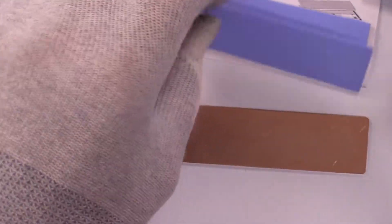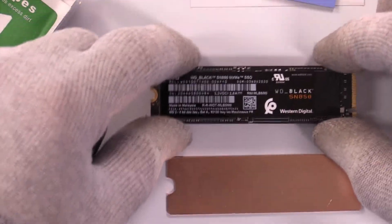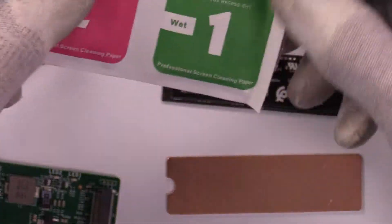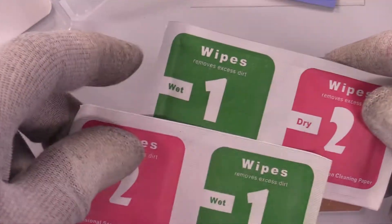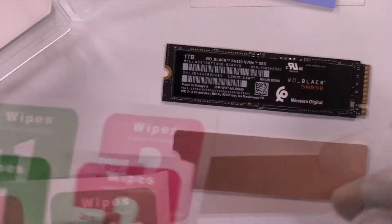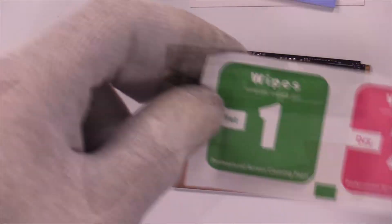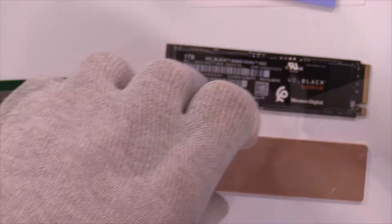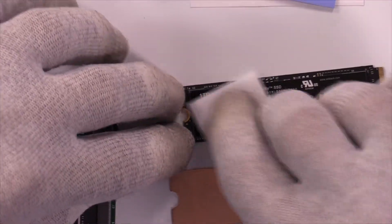In this setup, the thick pads are closest to the copper. As always, follow manufacturer's instructions. They've also included two sets of pads — surprised — so you can use one pad on each of the copper heat sinks. I'm going to use the wet wipe on the memory. I'm not taking off the labels, and yes, taking the labels off would reduce heat, but if I took the labels off I wouldn't know which drive is which, and with the testing we do I have to know who's on first.